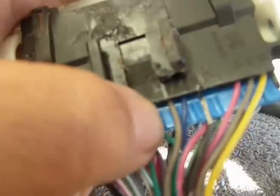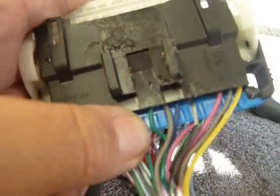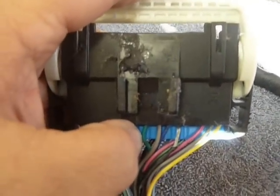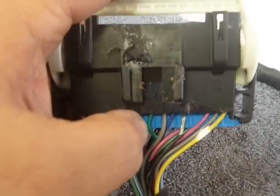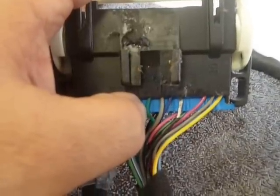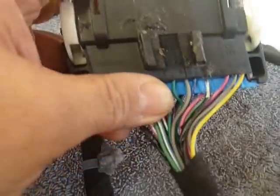If you look through to the other side behind it, you can see a green wire, a gray wire, and a blue wire. On the back side, number 7 just happens to be that gray wire right there, in between the green and the blue. That's your hot lead. If you tap into both of these, your footwell lights or whatever you want to connect to this will come on any time the door is opened, or if you hit the unlock button on your car or lock, it'll do the same thing.